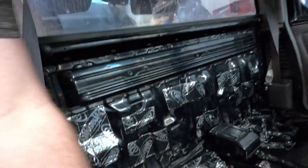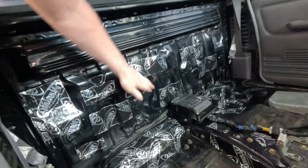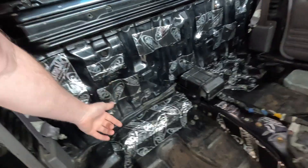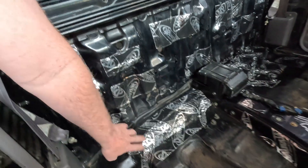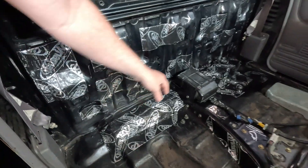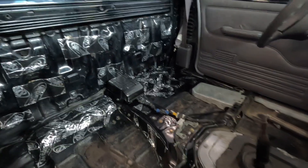One last thing: on the inside we started adding sound deadening, because one big thing with homemade EV conversions is that you get a lot of noises you didn't notice before when the car was gas. Suddenly when you have an electric motor it's really quiet and you start to hear all the rattles, road noise, and other noises you wouldn't normally hear. We put some Dynamat in the back and that'll take out a little bit of the echo. I also had to do some massaging of the floor — slices, hit it with the hammer, and weld in some new pieces of steel — to get a little more clearance around the battery boxes, then got those covered in Dynamat.